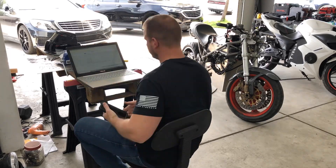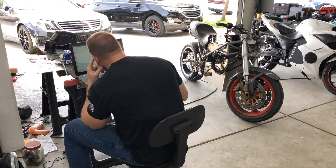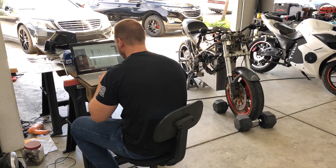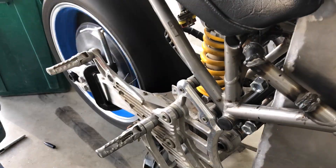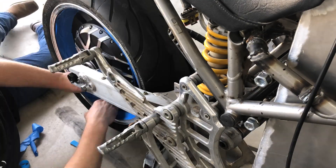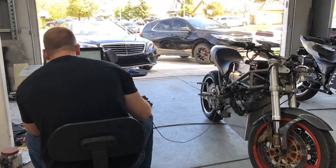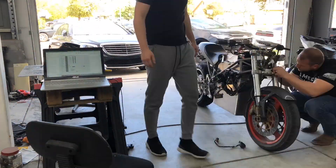From there I moved on to fine-tuning the controller. Before I started I took pictures of all the settings as they were, in case I needed to revert. I will do a separate video going through all the programming parameters. I've never seen a hub motor as unbalanced as this one — balancing a hub motor is not as easy as a normal wheel because they don't spin freely. I used a modification of a procedure from the YouTube channel DIY Lithium Projects, but the run-out method didn't work because the imbalance was caused by thicker steel on one side, not an off-center effect. Instead I used my programming app, placed a 100-gram weight on the wheel, recorded the RPM at which it started to shudder, moved the weight around until I found the right location, and ultimately found the correct placement at about 125 grams.